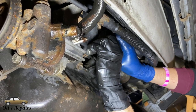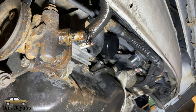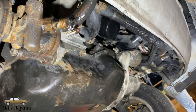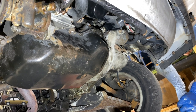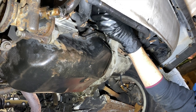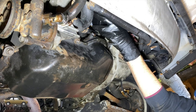We are using an oil filter wrench to remove the oil filter. Sometimes you can even just get them off by hand if you didn't tighten them too tightly. Screw it off just a little bit and then let the oil drip since it is at an angle. Make sure to catch some of that, and once the dripping subsides finish removing the rest of it. Once it unscrews, hold it vertically and it will be no problem.